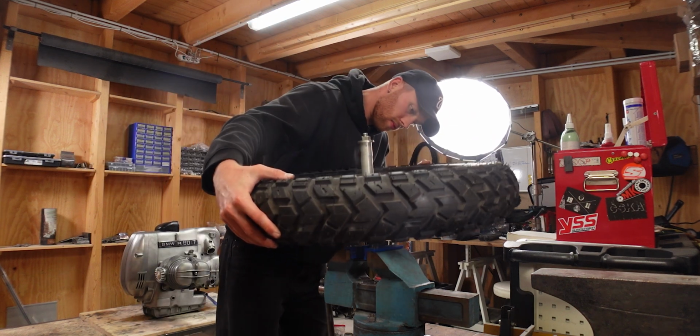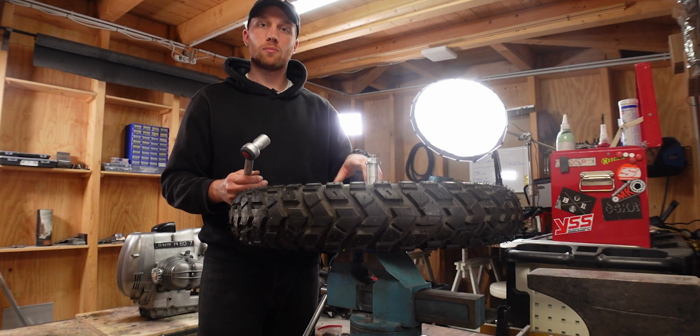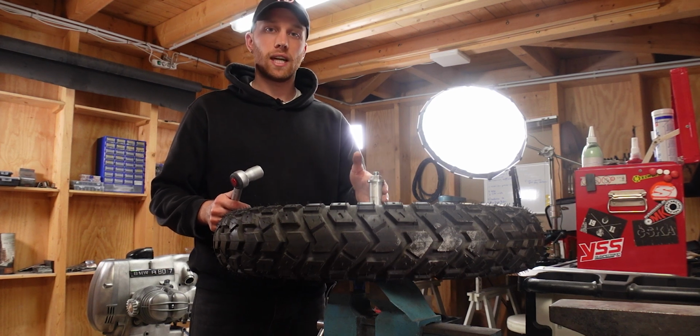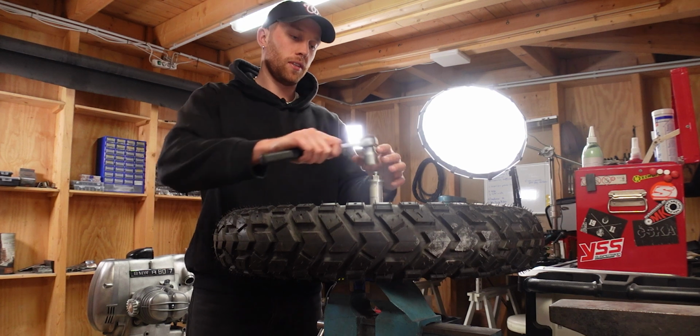Now I quickly put the axle in the vise so I can tighten this nut. And if you want to do this yourself, the combined length of the spacers that I'm using right now is 95 millimeters. The inside diameter of the spacers has to be bigger than the 17 millimeters of the axle, and the outside diameter doesn't really matter as long as the material is sturdy enough.